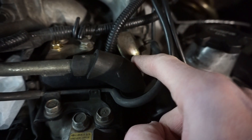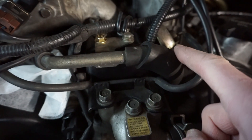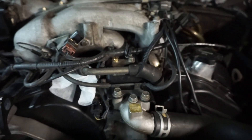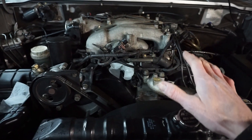I might have talked about it in a previous video, but the actuator arm can break. So if you guys are getting Pajeros now, this would be the first thing to check: take this bracketry off and just shine a flashlight down to make sure the actuator is opening up the long runners. If it's not, you're probably down 40 to 50 horsepower — like I was for a whole year.